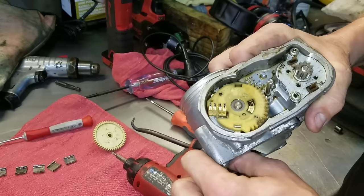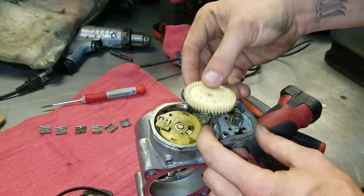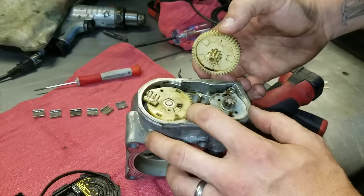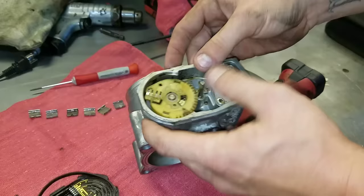With the innards of this, the cover comes off with a couple of clips. You have your main drive gear that comes off the DC motor — a 12-volt DC motor going back and forth. The drive gear sits on top and drives the secondary gear, and underneath the secondary gear it engages your throttle plate gear. Very basic concept: DC motor turns one way, valve opens; DC motor turns back. The spring also helps it come back. You can get a good view of the primary gear on the throttle plate once you pop the secondary gear out of the way.